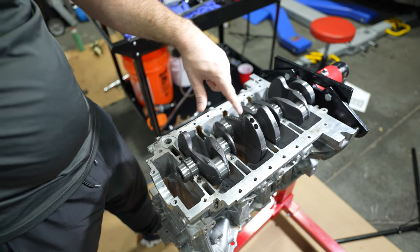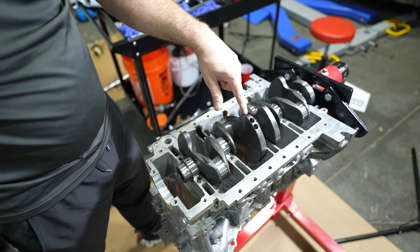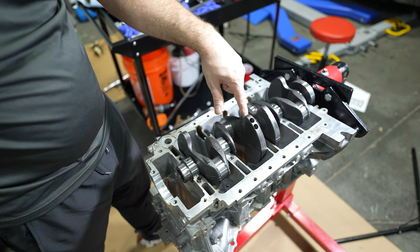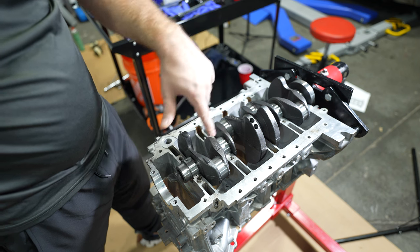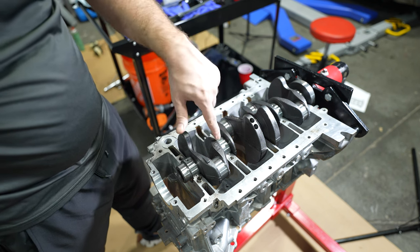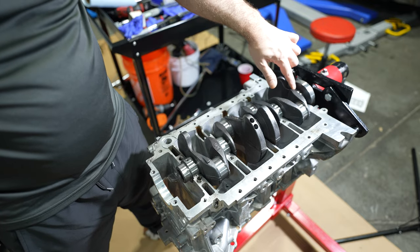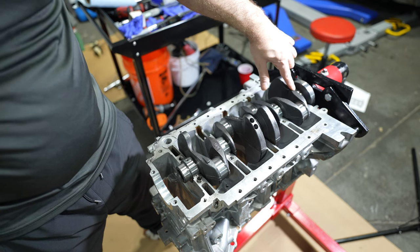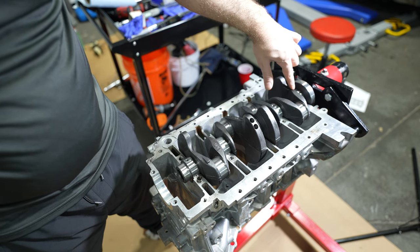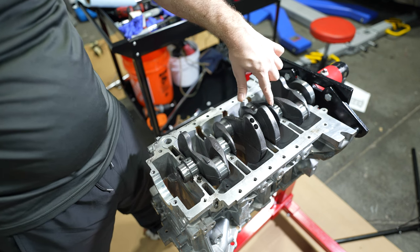So with these original bearings that I got with my kit, everything checks out. Even when I put my guide bearing, I chose a lower guide bearing that was looser to hope for it to be similar to these, and that all worked out. These are similar. They're all looking good. They all are actually beautiful, except for this last one's a little tighter. I could send it like this, but I have original OEM bearings. So what I'll do is I'll insert a yellow lower in this position, which should loosen that slightly to make it look more like the rest.